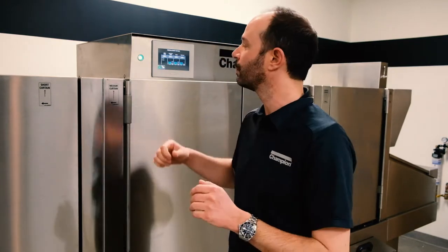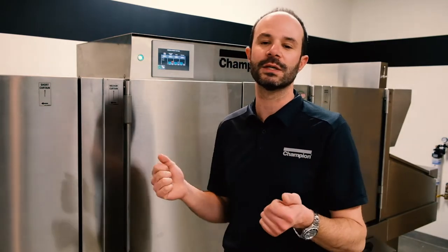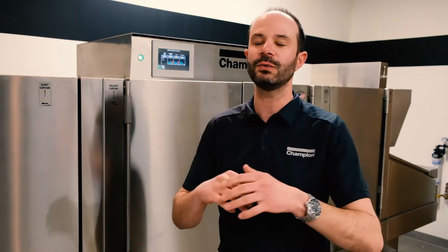We'll get into all that in this video, but first things first — we always want to make sure we're being safe no matter what type of cleaning we're doing. That comes down to the basics: if we're going to open up these doors and grab different items, we always want to make sure the power is off and the water is drained — whether it's an automatic draining machine or one where we open the valves — and leave the doors open for a few minutes to let the inside cool off. We don't want any burns or contact with very hot water. Safety is always number one, and then we'll get into our in-between meal period cleaning.